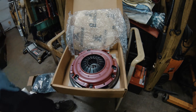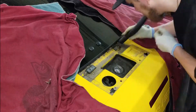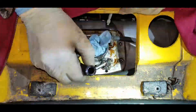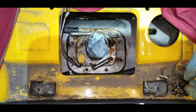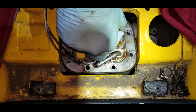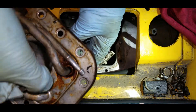So the first thing you want to do is remove the filler gate, then clean up any debris. Maybe put a rag inside the filler neck so you don't get any dust in there. I like to blow it off around the gasket area with compressed air just so we don't have any debris falling back into the tank. These fuel pumps are really easy to change out. This one in fact has an aftermarket regulator on the rail, so I don't think it should be an issue with the Walbro 450. With a factory fuel pressure regulator it may not be advisable because it may overpower it — I have to find out what manufacturer that regulator is.